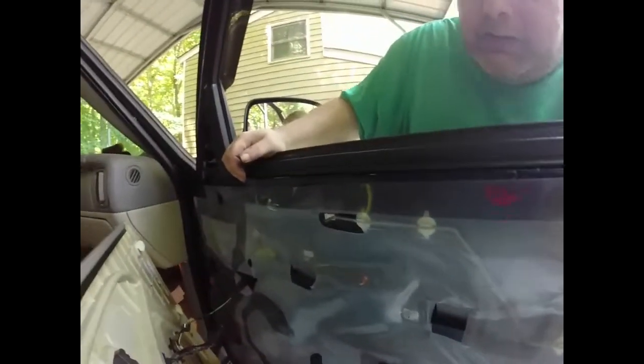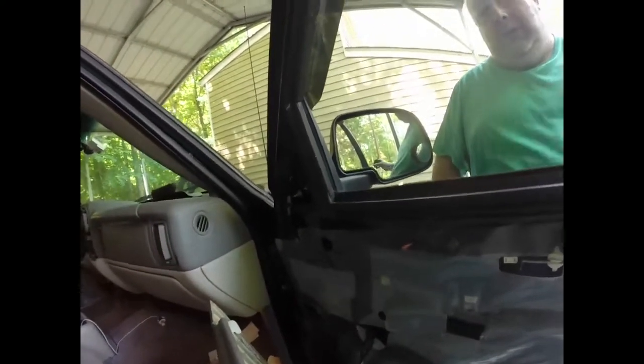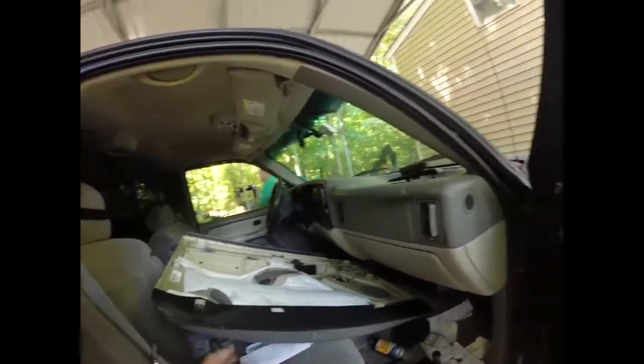You've got the plug there for the light, and the plug there going for the window switches and the speaker. Unplug those. There are other wires in here that we're going to have to loosen up and push through. It's a 10 millimeter for the door handle — easy enough to take off. The speaker was going to be easy. It's super easy on these — almost like just a press fit in there. So the door panel's off, wiring's out.